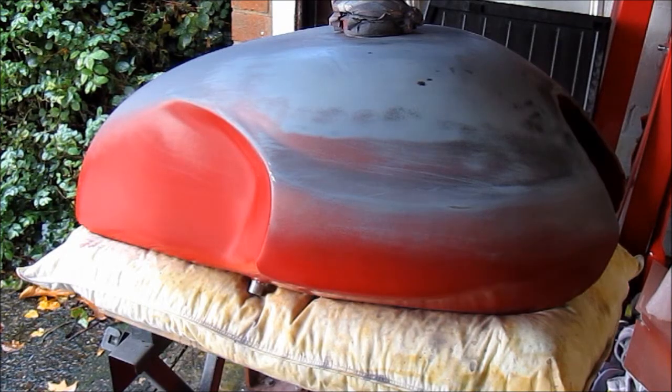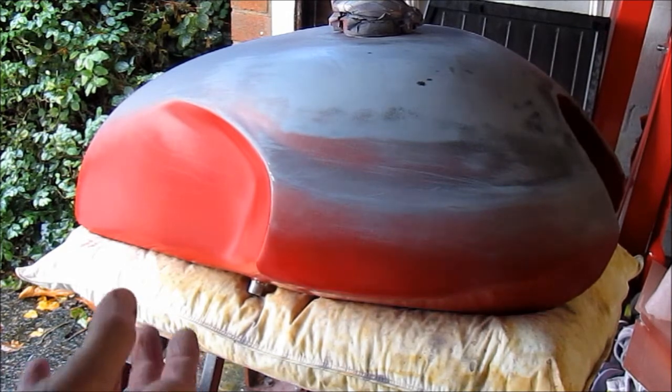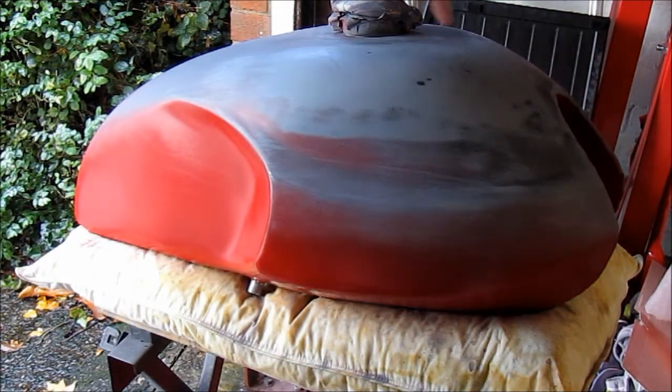And talking of the tank, here we are back in my garage on a very wet day. As you can see, I've been busy painting this tank. It's been etch-primed, primed, and the base has been painted with Ford Radiant Red. I did that first because I found it impossible to hold the tank in such a way that I could paint the whole thing in one go. But I've now got a problem in this area here, where I've got a couple of small dents.